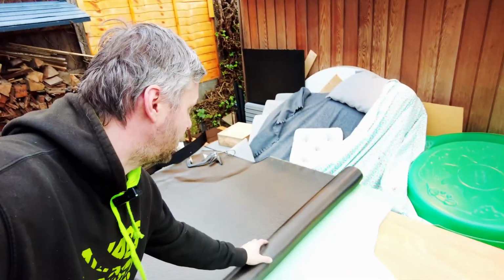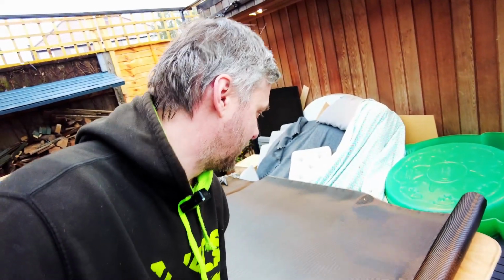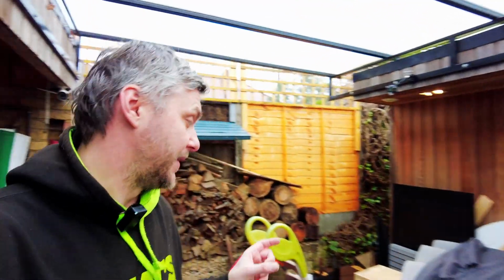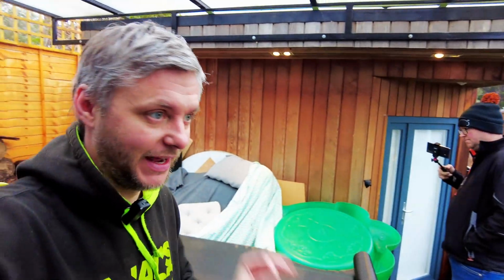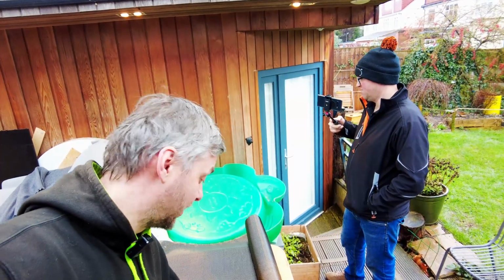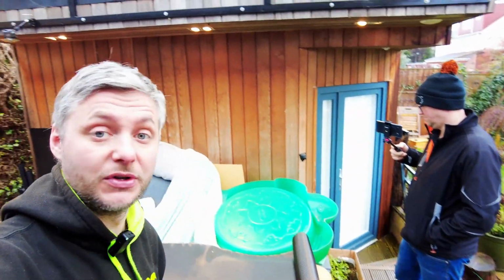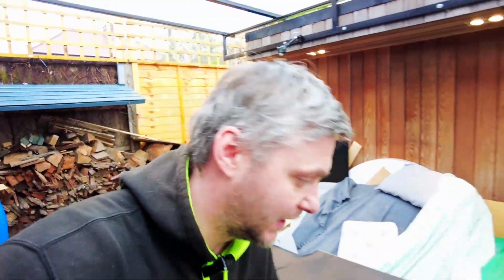So we literally just roll it across whatever surface we need, and then what I found the hard way, you need to leave a sufficient amount of margin on each side, because carbon has a tendency, especially when it's wet, to slightly start shrinking and moving, and once it's wet it's almost impossible to put it right. So if you cut your material and you're trying to be really cheap, like, oh, I want to do it as cheap as possible with as little wastage as possible, there's a very good chance that it's literally not gonna be enough, and it will stretch onto your mold. So it's always good to leave at least 5 centimeters overlap on each side. So this is what we have here, 5, but we'll leave a little bit longer.